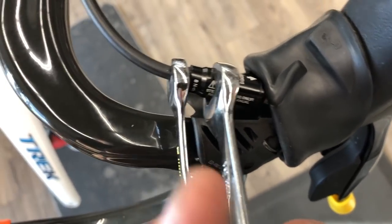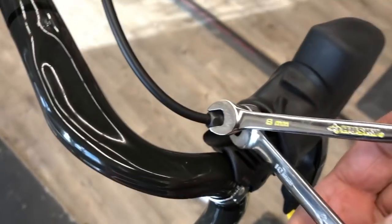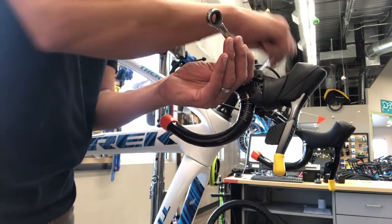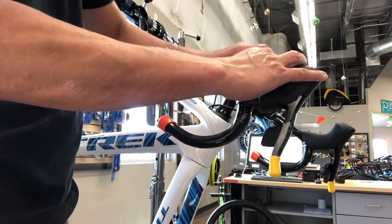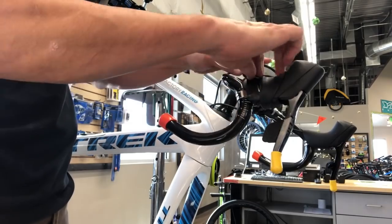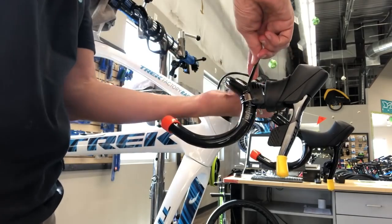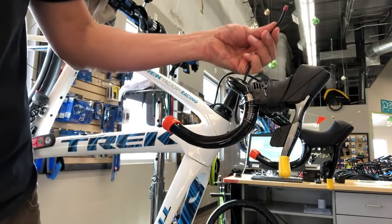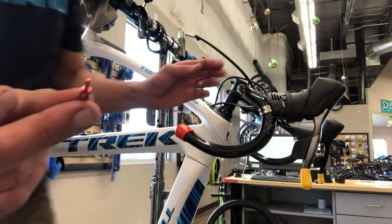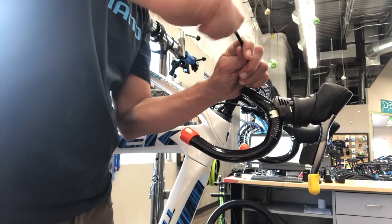To shorten the hoses you'll need a 10mm and an 8mm open wrench. The piece pivots up and down and basically just threads the compression nut in — pretty simple setup if you do it right. You can angle the piece with the 10mm flats upward so fluid doesn't leak out. Once you take your hose off, just hold it upwards and you generally won't get any fluid leakage.